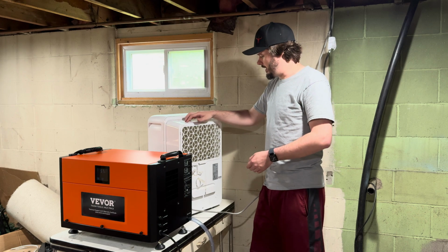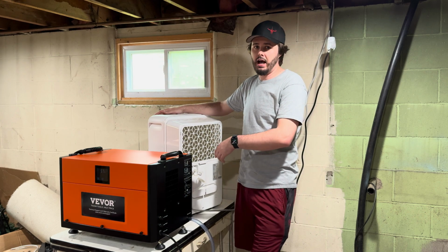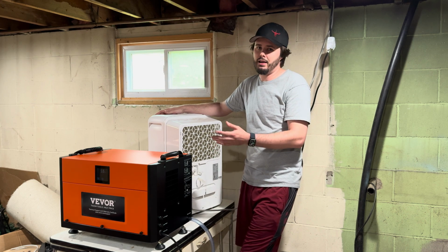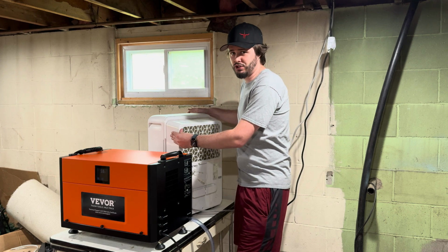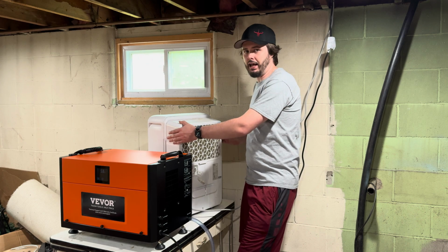But in a dehumidifier, these coils need to get cold so water condenses on them and drips off, but not so cold that it freezes. So a slight tweak in its balance and they end up breaking. Whatever they're doing now, I don't know if it's new Freons or just the pumps are actually that cheap these days, but they just don't last like they used to.